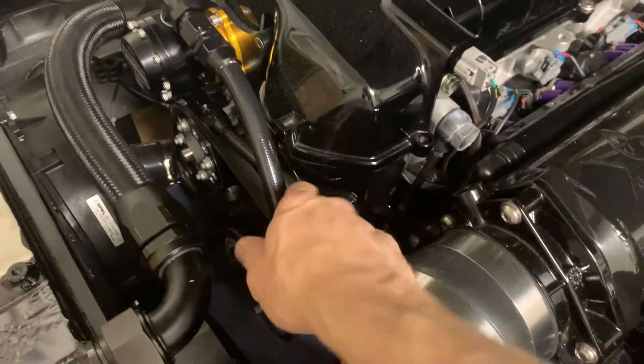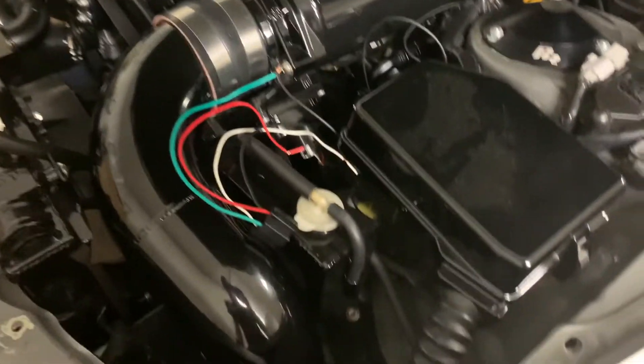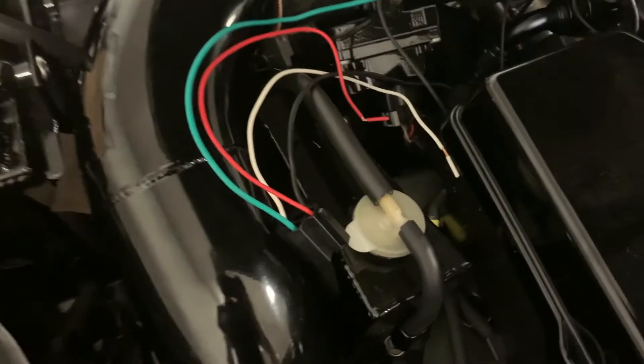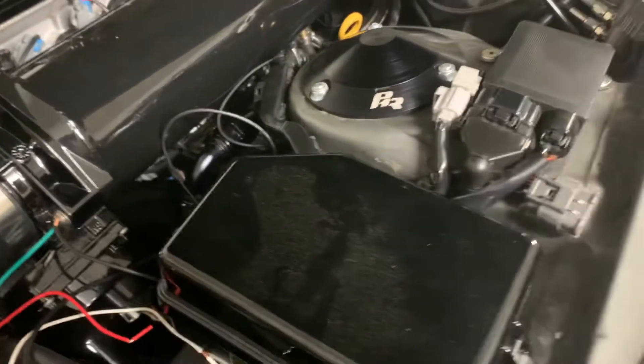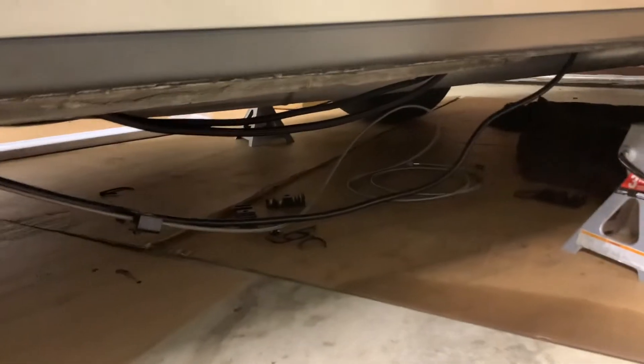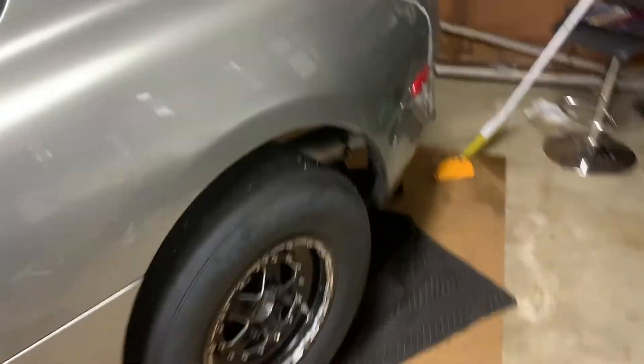I'm going to change this feed line to 12 AN and finish up the rest of the tank install once I get the rest of the fittings and filter and stuff like that. So the nitrous kit got put on pause a little bit — I ordered a couple things so I can do a cleaner install with this relay. But we have the solenoid mounted down there, the nozzles underneath here with the line I already ran to it, the line from the solenoid to the bottle underneath the car. I just have to run it along with the fuel lines that I'm waiting for for the new tank setup.